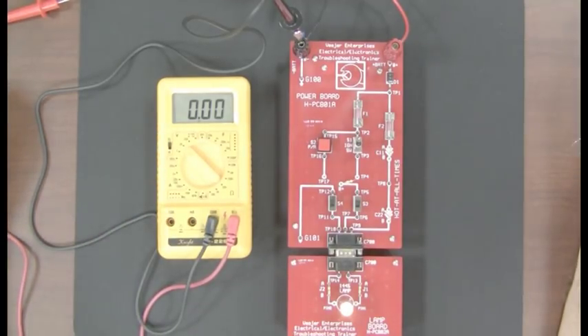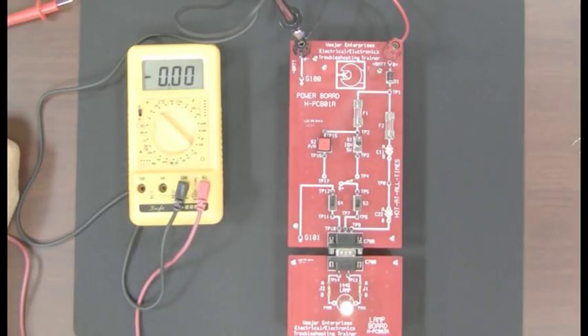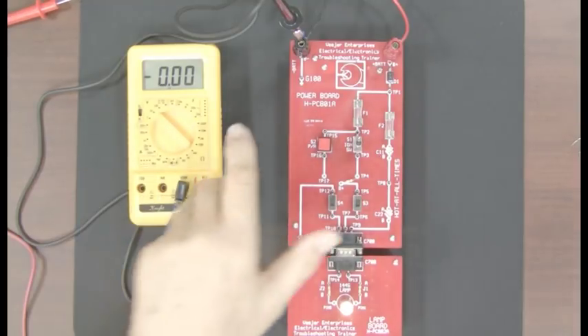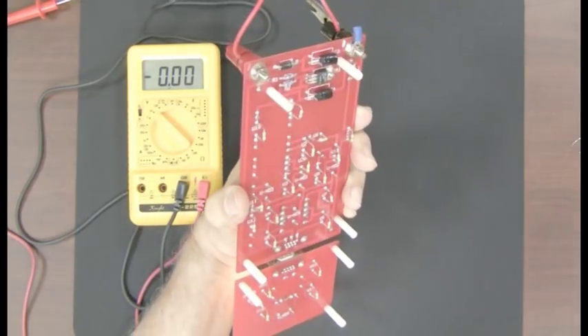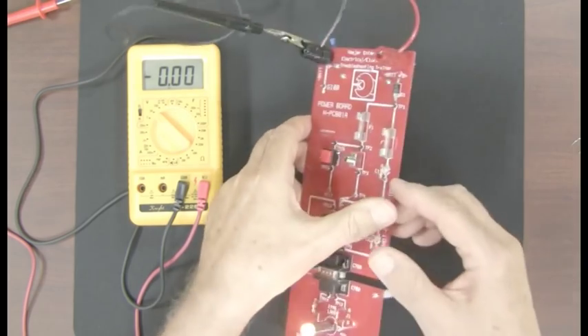There are about 33 pages in the workbook of exercises, and then you troubleshoot a total of 28 problems with open circuits and voltage drops. That's how you learn how to troubleshoot — you practice, do it over and over, and build your confidence. By following these simple troubleshooting techniques, no matter what problem is put in the circuit, you quickly identify whether it's a voltage side or ground side problem, or possibly both.